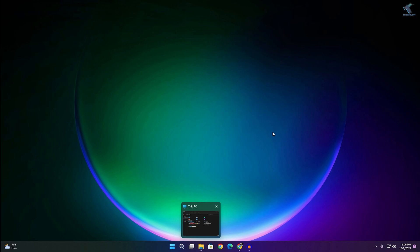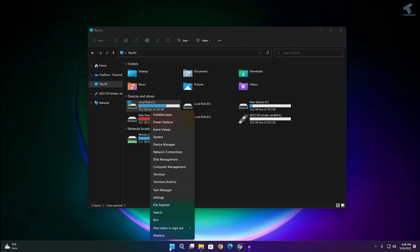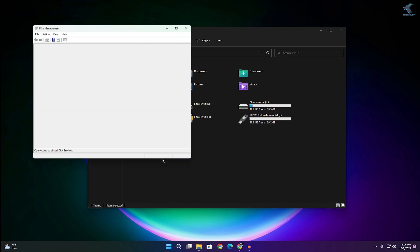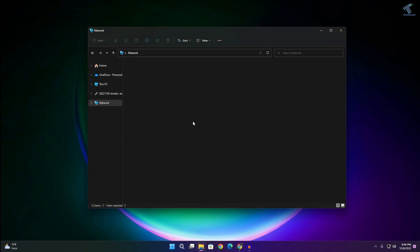After the PC reboots, open My Computer and you will see your C drive showing. Here is my new C drive. If you're confused whether it's your new or old C drive, right-click on the Start menu and click Disk Management. You will see Disk 2 which is the old hard drive — 250GB — showing offline. The new one is 1TB. You can easily expand your C drive size from here.